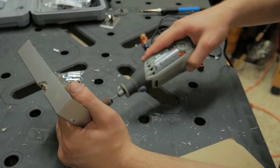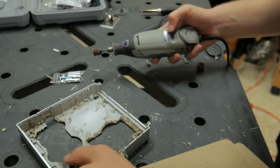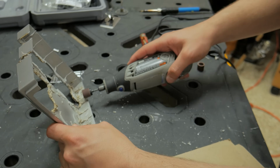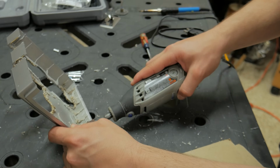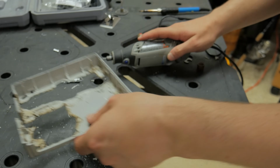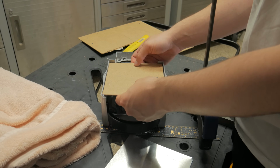This added a few inches of available height within the enclosure, which in a small form factor build is a godsend. I then cleaned the inside up a little with the Dremel and a low grit sanding wheel. Because the bottom had so many holes in it from the original removed covers, I needed to make a bottom mounted tray that would close off the system and be a backplate for the motherboard to mount to. So I cut out a piece of picture frame backing that seemed like it would be a good fit.